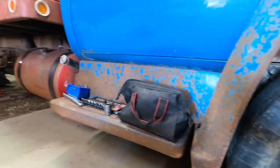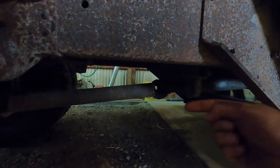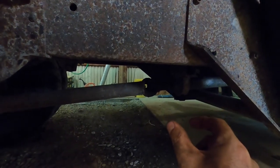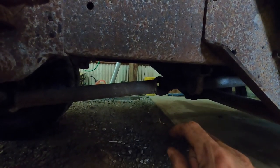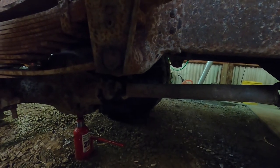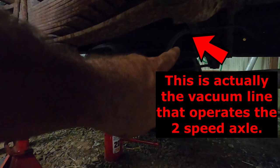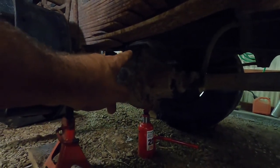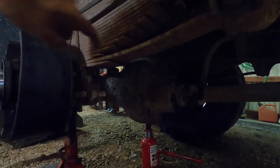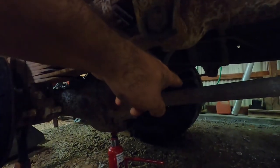Now, when we start looking at the back, we've got a brake line that comes back. When it gets to underneath the cab, underneath the driver's seat, there's a little block along the frame, and it starts a new line. I think from that connection back, we need to replace all the brake lines. I think we're gonna try copper and see how it goes. Once that line gets back here close to the back axle, up along the frame, it goes to a rubber hose, drops down to the axle, just above the differential, and then goes into a distribution block from that rubber hose that sends it over to this side and one over to the other side.